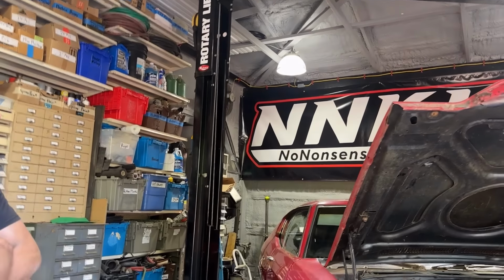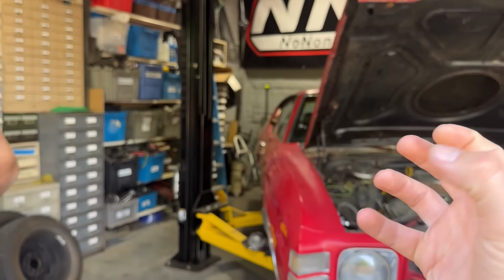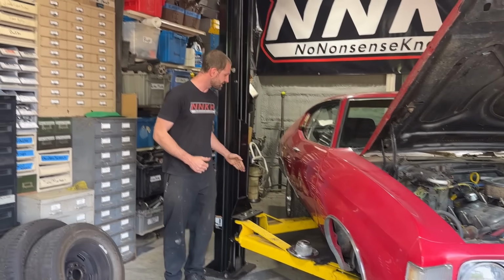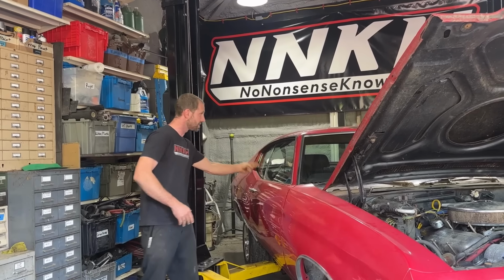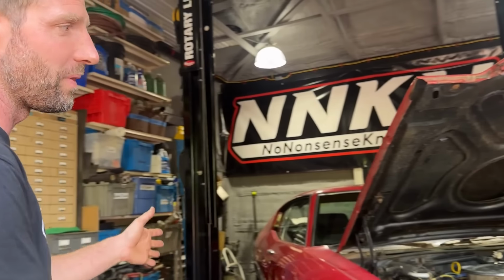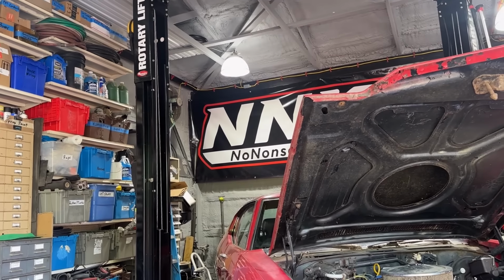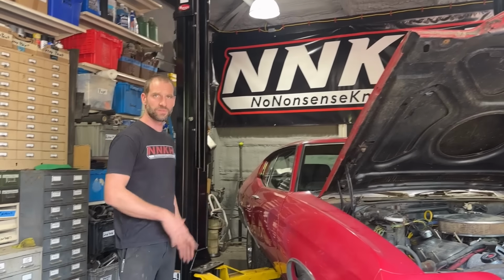So what's the point of it being asymmetric? That means those posts are pointed out, right? Yeah, rotating the columns moves the imaginary center of gravity more to here instead of in between. The idea is when you pull a car onto the lift, you can open the doors easier, because you're leaving about 75% of the car out back and 25% in the front.